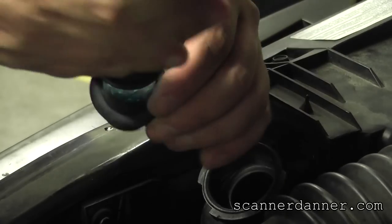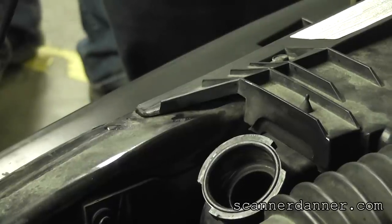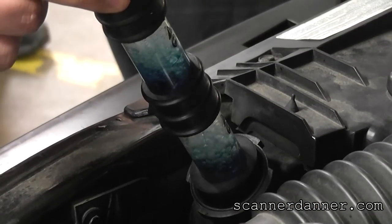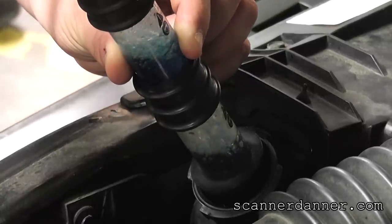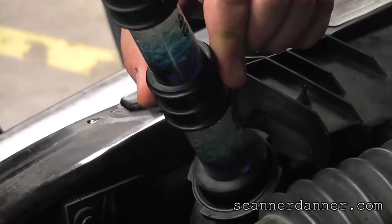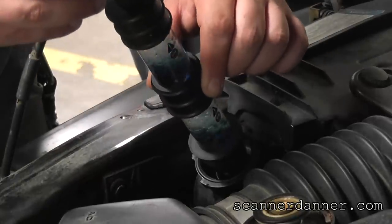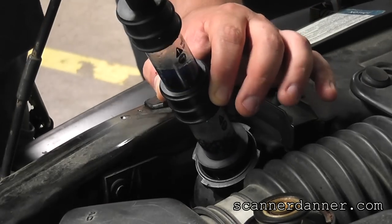I'm going to start it for a second - stand back away from it. Hopefully we'll get a long crank time out of it. Keep going - should be turning yellow. We have confirmed head gasket failure. I don't want to condemn this kit - do we have contaminated fluid in that bottle? Did somebody do something with this? It is not changing color. There is no way we can rely on that.